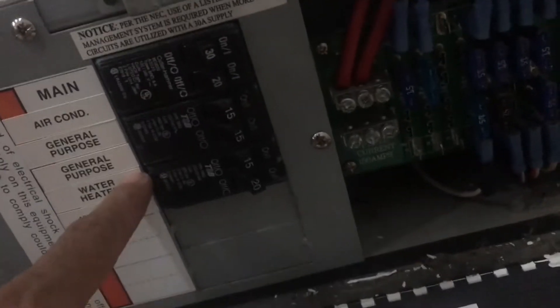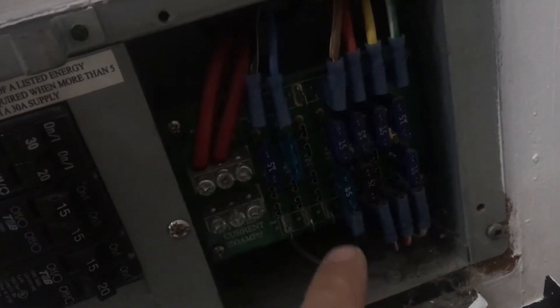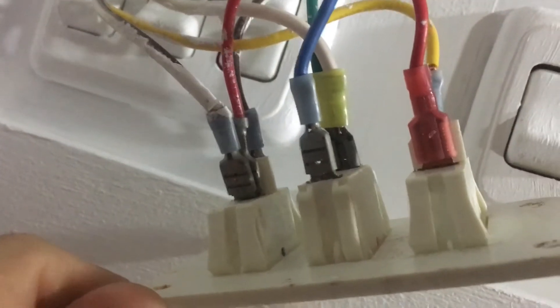On these models, you want to make sure that the switch that turns on your water heater has 120 volts going to it — that goes to the relay — and 12 volts going to the circuit board outside. What happens is that the circuit board signal goes straight to the switch and back. First things first, you test your switch. Open that up — that is your gas side, that is your electric — and you test this for 12 volts with it on. If you are not getting 12 volts, you have to trace this wire back.